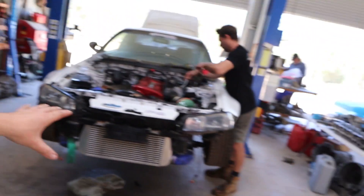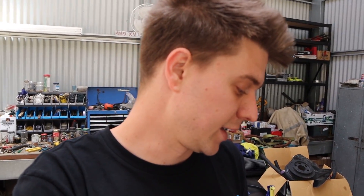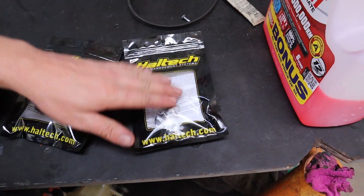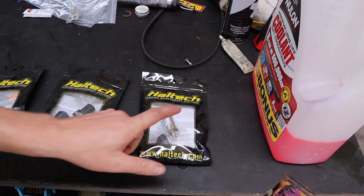The RB25 was a little bit different because they had their factory heat exchanger for the oil cooler setup where you actually put the oil filter onto, and they had the factory oil pressure location off that convoluted setup. We've removed that on Brad's engine — he's got an external oil cooler. In the RB25 blocks, they still have the same provision behind that area for the oil pressure, and that's where we've actually got the analog gauge at the moment for startup. I'm going to remove that and put this Bosch sensor in, giving us pressure and temperature in one easy sensor. Then we've got this Haltech 150 PSI pressure sensor, which we're going to use for fuel pressure — it's a TI sensor — so I'll find somewhere in the system to monitor fuel pressure and tune in protection parameters.